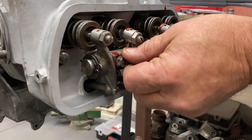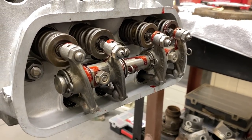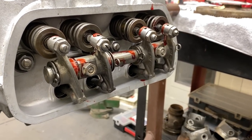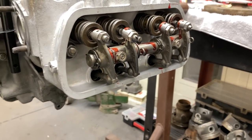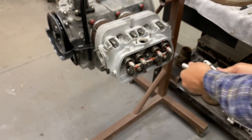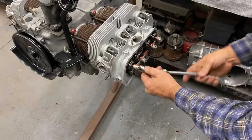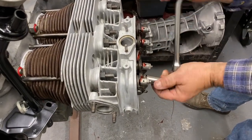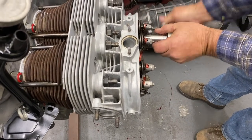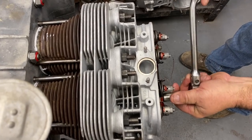Moves probably... these tubes are quite a bit, you know. I guess everything's just smaller on a 40 horse. Yeah. So we'll make room for them. And these are torqued to 18 foot-pounds. I usually just tighten them by hand because I'm pretty good at 18 foot-pounds, but we can go ahead and torque them if you like. Yeah. You've done it so many times, you can feel it.